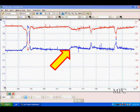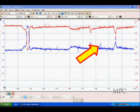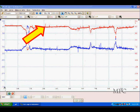They swap ends of the circle. We hold a steady throttle relatively, then move it slightly and you see one go up and one go down — they're going in opposite directions. Down here, we snap the throttle open again, so you can see a number of places we've opened the throttle. There is some noise present on both of these sensors. You can see a small bit of noise in the blue trace — two significant spikes that do not show up in the red trace. That is fairly normal; we do get a little bit of noise.